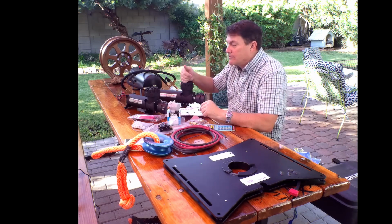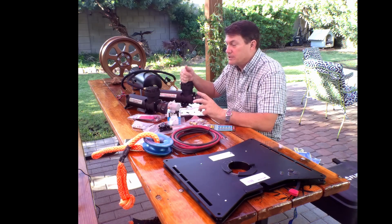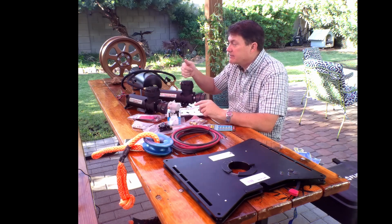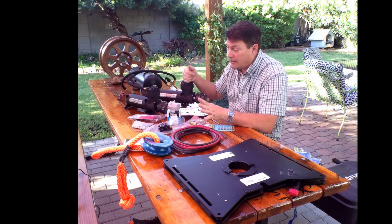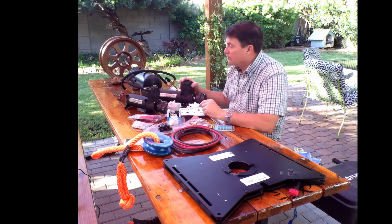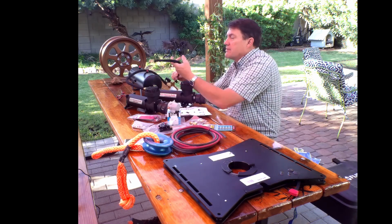But we did two of the compressors because each one draws 30 amps, versus 40, 50, 60 amps out of one particular compressor. So I can really go crazy. I can put them on switches and run one at a time. It does give me redundancy if one dies. I've never had Extreme Outback stuff die, but George is all about cool ideas. And plus, if you wanted to mount one in neat places and you only wanted to use one, it'd be great. We're going to go two. Make sure little things matter.